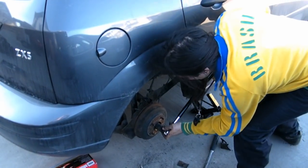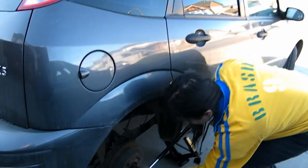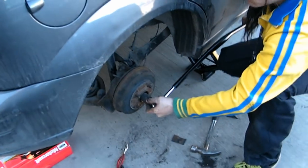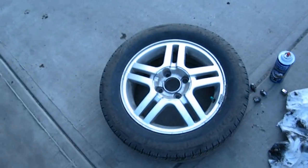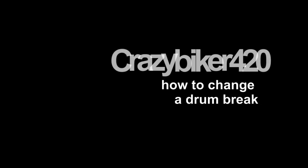We actually take bike handlebars and stick them on a socket wrench to gain leverage in order to get the bolt tight enough. You should use a torque wrench — it's 173 foot-pounds torque. Don't forget to put your dust cap back on. Next, get the wheel on and take it for a test drive. Thanks for watching my how-to — should be lots more coming in the near future.